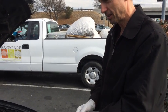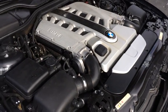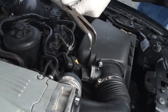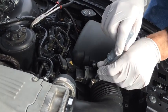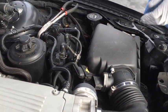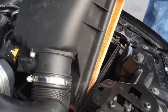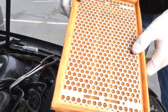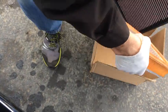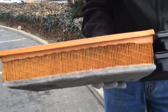I'm going to take off these stock filters and put on the K&Ns out here in the jungle — not a fun job to do out here. I'm going to just loosen this a little bit, it makes it more friendly. It's pretty new, it's got a little bit of dirt right there but it's pretty new otherwise. And here's the difference in media — two K&Ns equals one paper filter. That's kind of interesting.